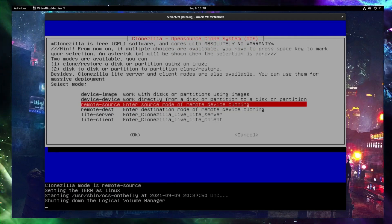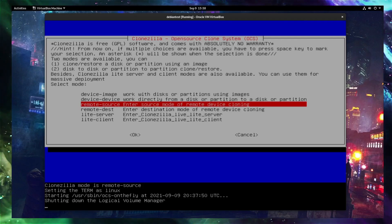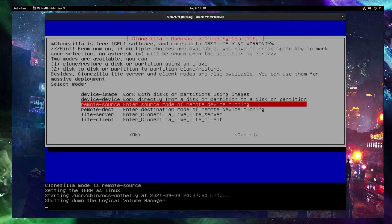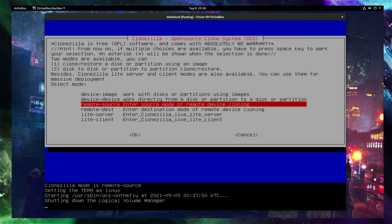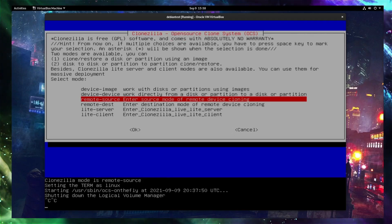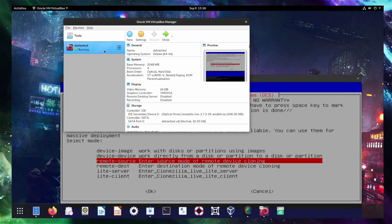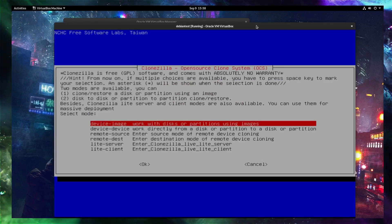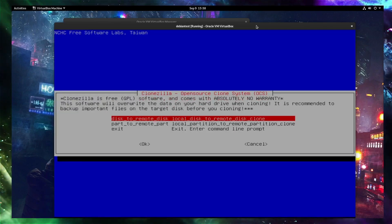This can do like up to 40 at a time or some ridiculous amount of clones, but I'm only going to do one today. So I'm going to pick the source. And then — this has been known to happen — you'll notice this is kind of stuck here. Clonezilla does this a lot, so don't worry about it. I'll Control-C out of it and let me just go back and check. It should bounce out of here — and it did. Just rerun it and go back into Clonezilla. And then it should work. This happens all the time, like I said.